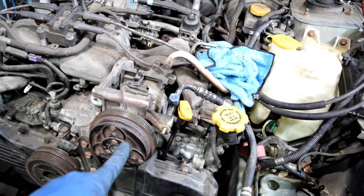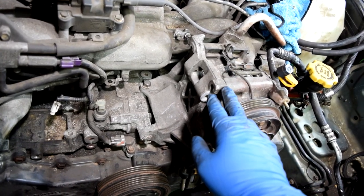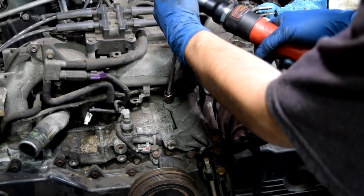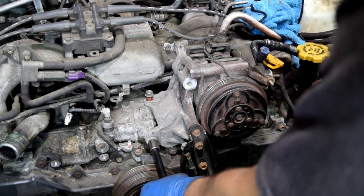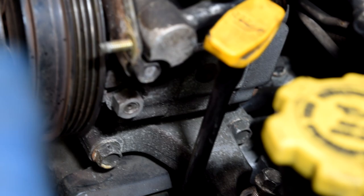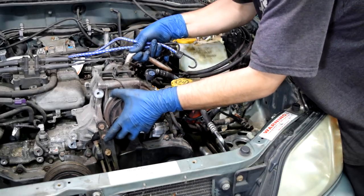With our fuel lines disconnected, now we're going to remove our AC compressor with its bracket and assembly without disconnecting any of the AC lines. As far as I can tell this AC bracket is held in place by five bolts: two on this side and three on the other side. Since we're removing the compressor with the bracket, we don't need to touch these two bolts — we just need to remove this one and then the one in the back. Now we should be able to get this out of the way. I'm going to split this repair into two videos, and this is going to be the end of the first episode. I'll put a link to the second episode on the side of the screen. If this video has piqued your interest, please give it a thumbs up, subscribe if you want to see more, and I'll see you in the next episode. Thanks for watching!